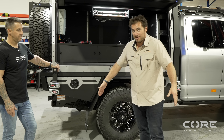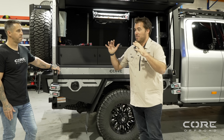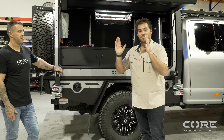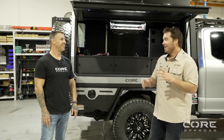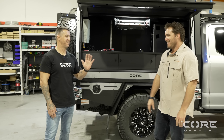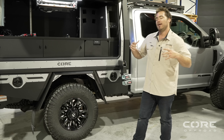With anything you're manufacturing you need to have tolerances — it would be perfect if that leg was one tenth of a millimetre, but you need some tolerance for manufacturing; otherwise it's too much of a pain for the customer to get it in. One thing you'll start to notice with the lift-off system is that the legs aren't straight. Our design was to create stability on the canopy when it's not on the vehicle by having the legs at five-and-a-half to six degrees out along that Y-axis as well, pushing out. As the legs are loaded, all of the force is pushing inward, as opposed to just being vertical. If you have something 1,500 mm long with one mil of play at the top, that equals roughly 15 mil of movement at the bottom — so with two or three mil of play at the top, over a metre that's a hell of a lot.